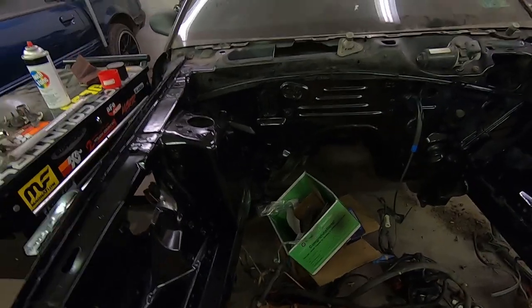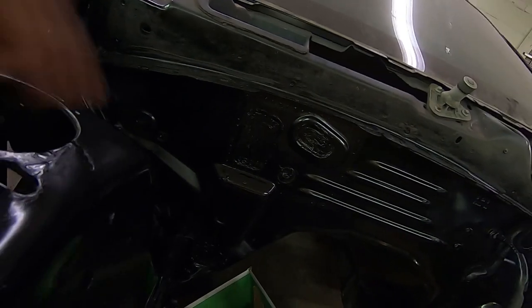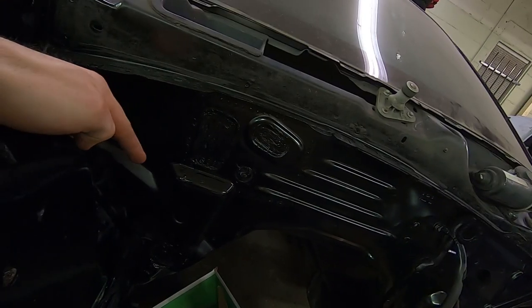So it's painted now. Whole engine bay is painted. Still need to swap the throttle cable to the 4.6 one. Here's the plates that I welded. I seam sealed them as well. Maybe I'll put the pedals on now so I could put my new master cylinder on and then I could start making brake lines. It even came with fittings.